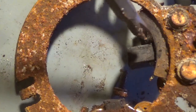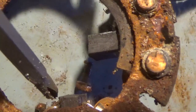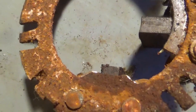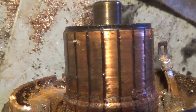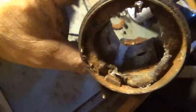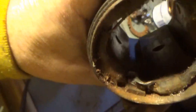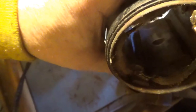If you look at this area where the brush is sticking out you've got no metal, and if you look at this area the metal is sticking out too far — so I'm just going to grind that down a little bit. You can see how it's been rubbing where the brush area steps up. On further inspection, it looks like somebody over-torqued the positive terminal and snapped the leads right off the coils. Hopefully we can fix that — might be easier said than done.